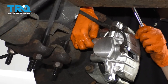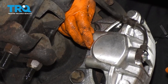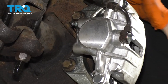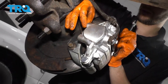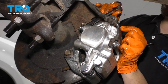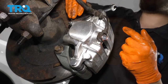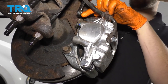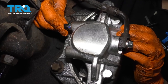With a 10 millimeter wrench, open up the bleeder screw and remove the little dust cap. Opening the bleeder screw will allow gravity to pull fluid down and push the air out. Once a steady trickle of fluid comes out with no air, close up the bleeder screw and snug it up. For the manual brake bleed, have someone in the driver's seat pumping up the brake pedal. Make sure your master cylinder is full. Once they hold pressure, open the bleeder screw — brake fluid and potentially air will come out — then close it, pump up again, hold pressure, and repeat until no more air comes out. Tighten the bleeder screw and don't forget to reinstall the dust cap, which prevents the bleeder from getting clogged with debris.